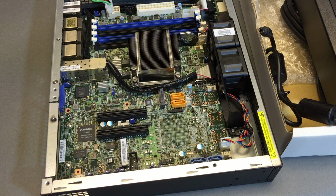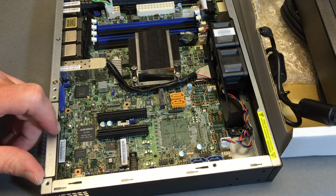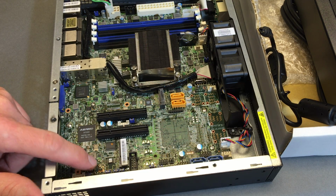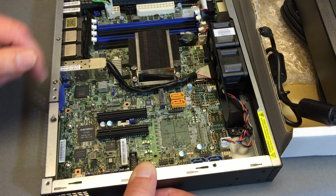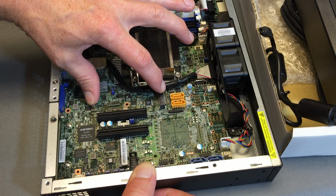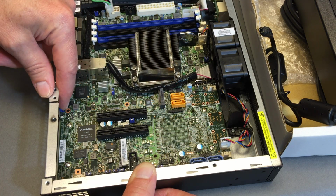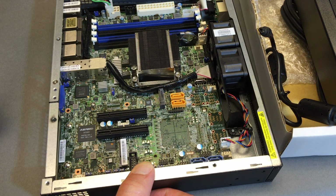All right. Notice we have another slot here. It looks like SATA, but that's strange because there's a screw here, a standoff up to the side. I'll have to get back to you on that one. Here we have 2280 by default for M.2. And we also have a further standoff for the longer size. So this one will fit different brands and different lengths, unlike the 200.